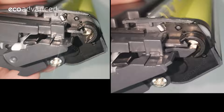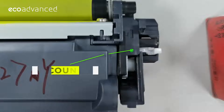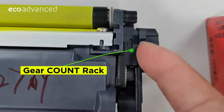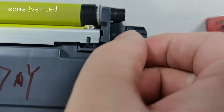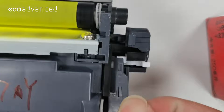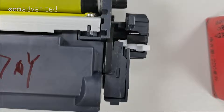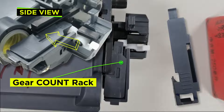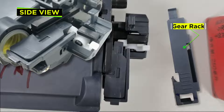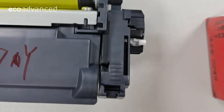Resetting the gear on the TN253 and 257 is really simple. Remove or slide off the gear rack. Lift and remove the count gear rack from the used empty position and move it to the new full position between the guide rails. This side view gives you a better angle showing the gear count rack tucked in between the guide rails. Slide on or reinstall the gear rack to the original position.